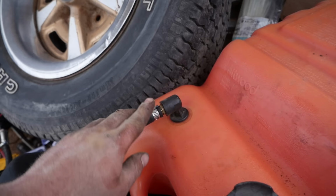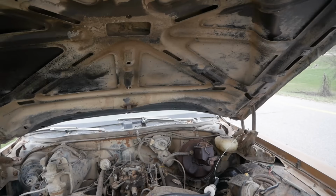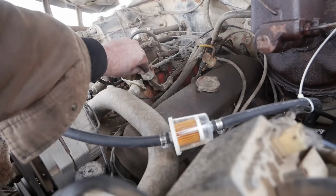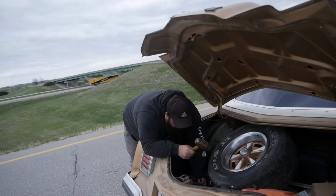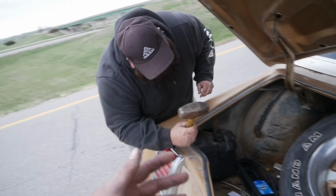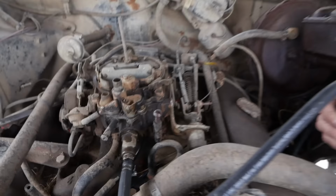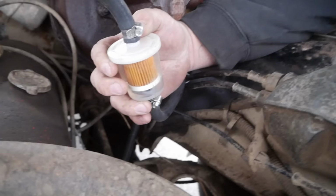Well, I guess we'll try to pop this off and just shove it in here and see if it changes. No, that didn't do anything. I don't know. Oh, there we go. Well, what happened? Plan D. We have determined that there is pressure at the carburetor, therefore it could be deadheading against a bad needle and seat, not allowing flow to occur, but allowing pressure to build up. And this is obviously how you fix that problem. It is filling more. We got lots of gas up here, but somehow nothing in here.